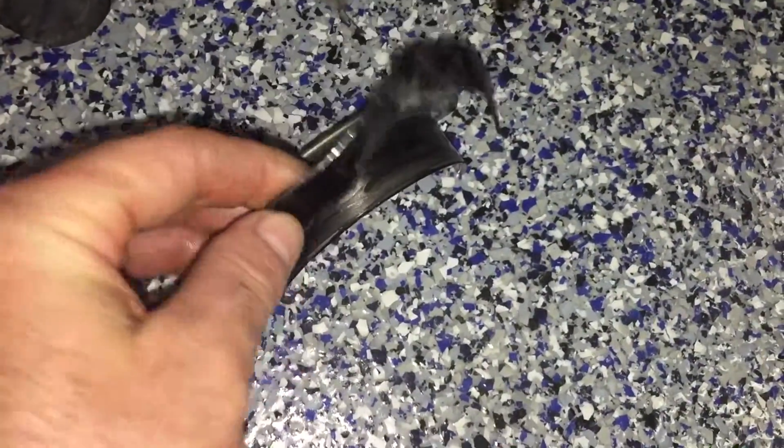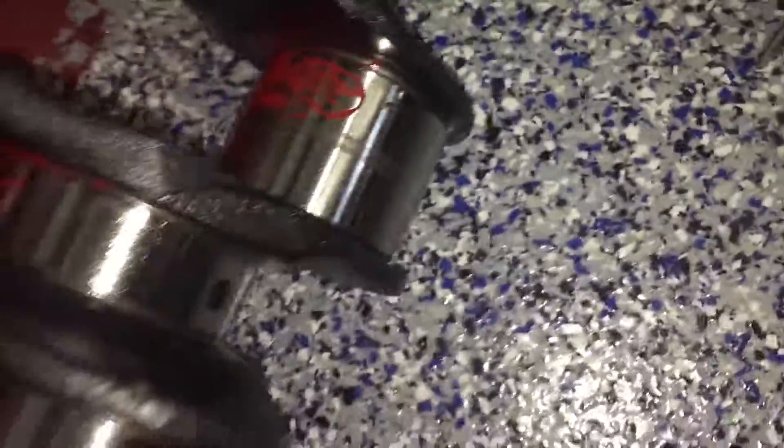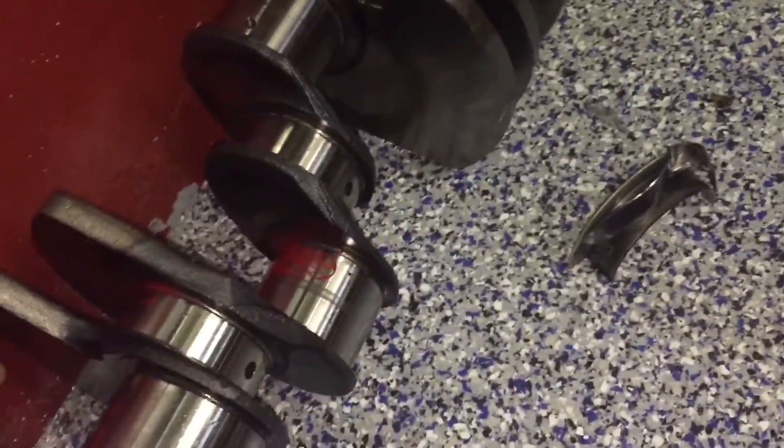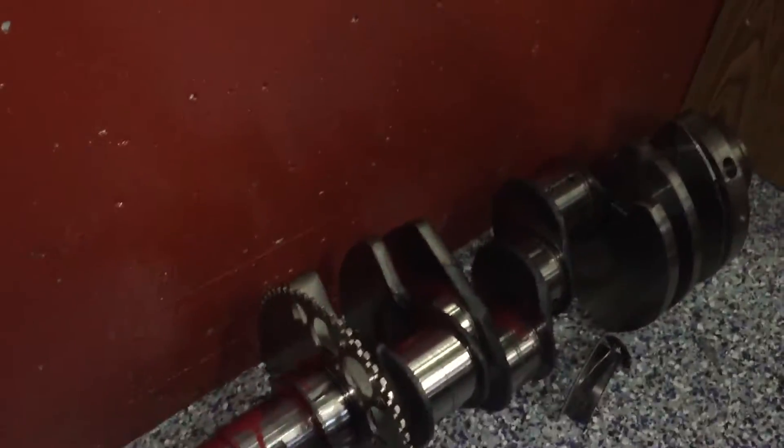It chewed a little bit. And look at the bearing journal — we painted it red. You can see the thrust journal right there. You can see this side is all perfect. It's at 125 thousandths in play. Everything else looked good, but that right there — I don't do oversized bearings, undersized, whatever they call it. Just throw the crank away, get rid of it. It's crap. We'll call it wall art, or yard art. Probably paint it solid red and put it outside.